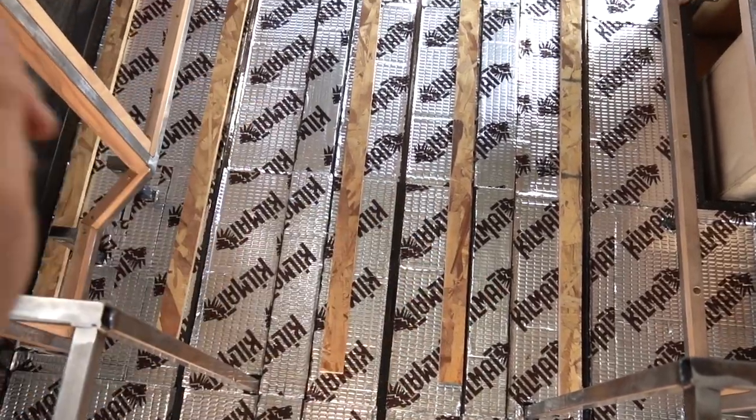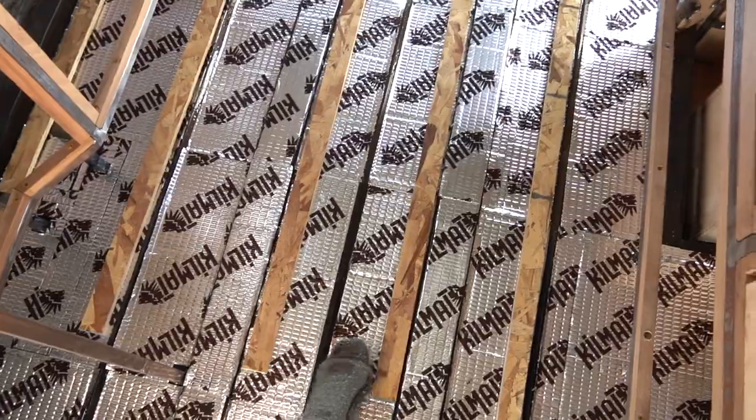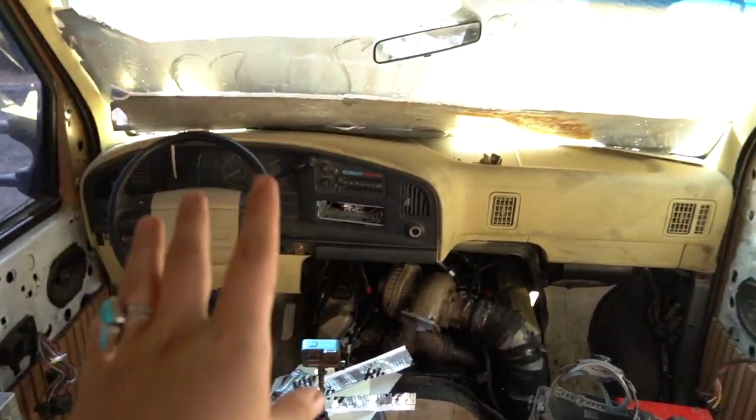There's a hole there, and we're going to be screwing stuff on top of that. We will be putting insulation in between the stringers and all that too. I'm also putting sound deadening up top above the seats. That way, if anything's up here kind of rattling or moving, it'll probably be quieter. These vans are pretty noisy, especially in the front area, so we want to do everything we can to make it less noisy.